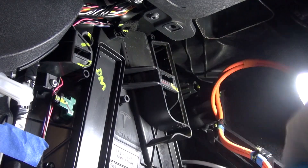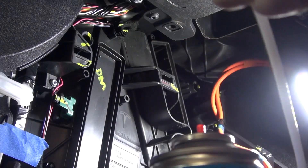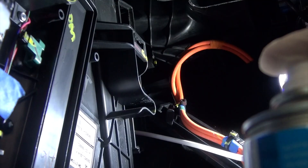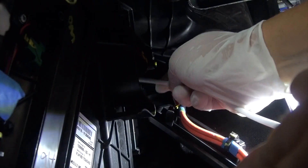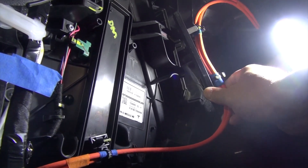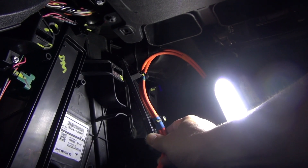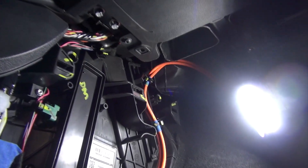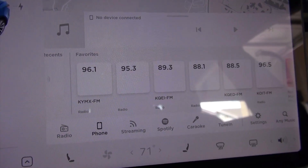The instructions say to shake it well before you dispense the foam, and it looks like it's going to be facing toward the evaporator. I'm wearing gloves just in case. So that's it — it does smell a little bit. Looks like the foam is dissipating really nicely. Hopefully this will do the work killing the bacteria. After you dispense the foam, you wait for 20 minutes. For now I'm just going to place the panel back on temporarily — I don't have the air filters in there yet because we need to run the AC. This way it will contain all the air pressure. After you dispense the foam, you have to wait 20 minutes.